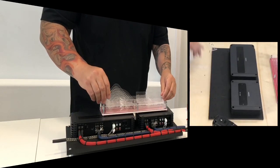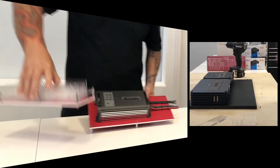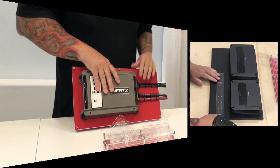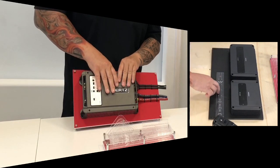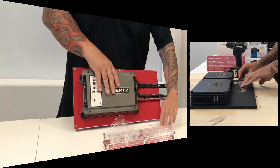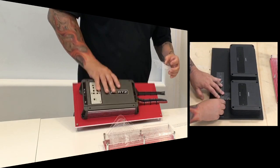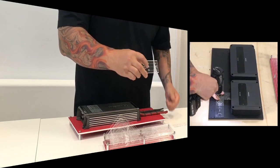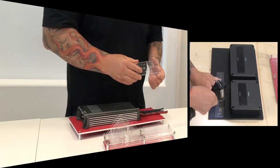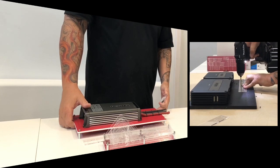That's one through three — corners and radiuses. The kit also comes with something really cool. What we looked at was these power tunnels, in eight-gauge or four-gauge, it's pretty common — they're roughly the same size. A lot of amplifiers: power, remote, ground. Normally that remote wire is separating the two. Along with the kit, it comes as two pieces: the dual eight-gauge power tunnel kit and the dual four-gauge power tunnel kit. The kit lines up and allows us to index and get that remote wire in. This one's a little bit different because on the center hole it is larger — the reason is so it can share a single zip tie instead of doing four holes. And the remote terminal leads are offset, so you've got the ability to do your power wire, your ground wire with three holes instead of four. That keeps them closer, and then offset on that you've got the distance for the remote terminal.